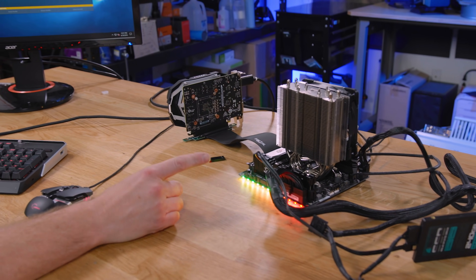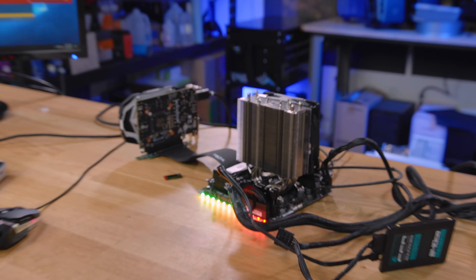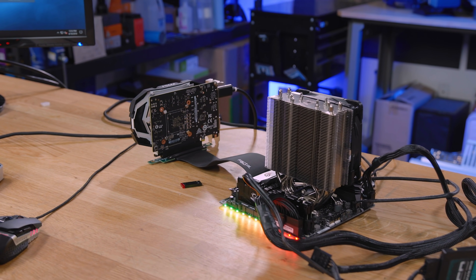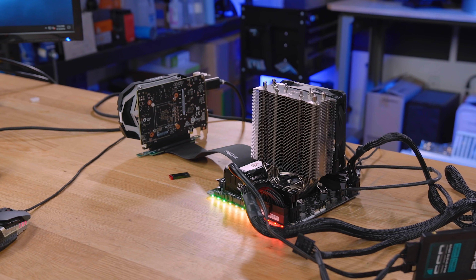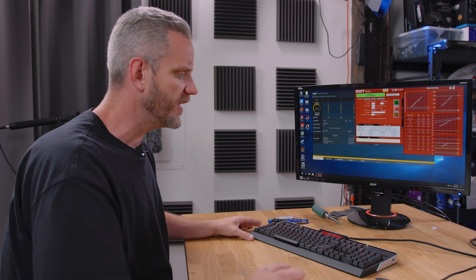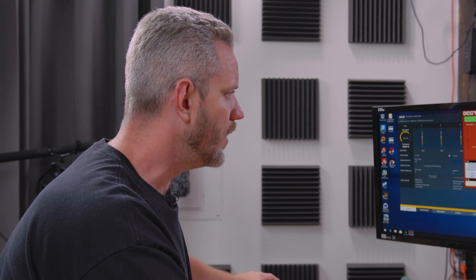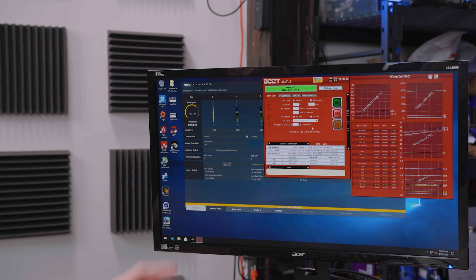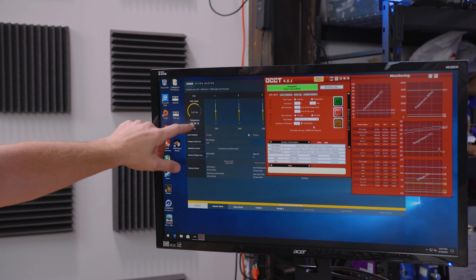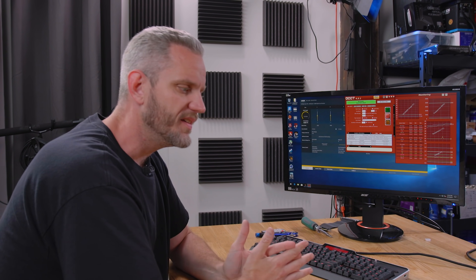So here's our setup: it's an AMD 1800X hooked up to an Asus X370i ITX board — the reason why it's ITX, you'll see in a minute. The graphics card is just a cheap 1050 without supplemental PCIe power because we want to keep it out of the way. We have an 850 watt power supply because we're not really trying to see what happens with the overclocks; we're trying to see whether or not this proof of concept would even work. We've had our test running for a while — we're currently at 59C and it'll warm up to approximately 63-64C at its hottest. This is the actual physical temperature number, not an offset. That's going to be our baseline.